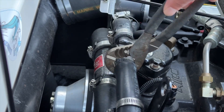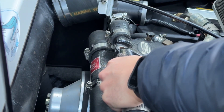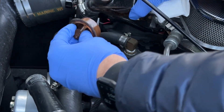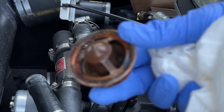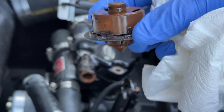See how it's moving now? That's all you need, and now you'll be able to remove it by hand. With that hose removed, I'm able to lift up the housing and pull out the old thermostat. You can see it's very rusted after 20-something years, so no wonder it needs to be replaced.